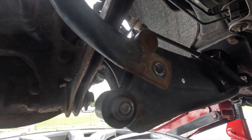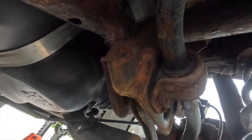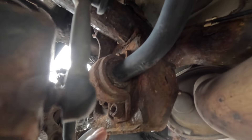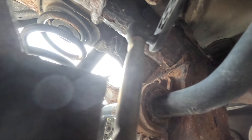If you've seen my video on the sway bar end links it's going to help you tremendously here. Now that both sway bar end links are loosened off on both sides, next up we've got to take these bolts out — one on the bottom and one on the top side on both sides. These should be M10s.